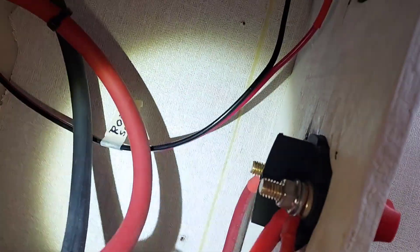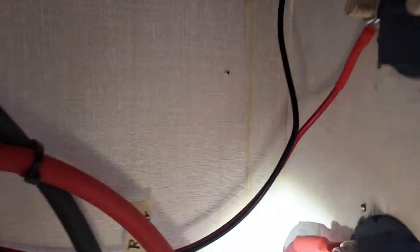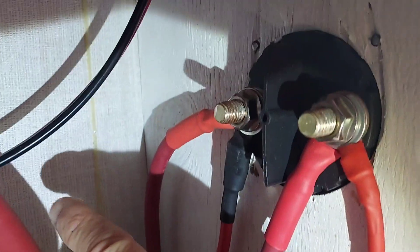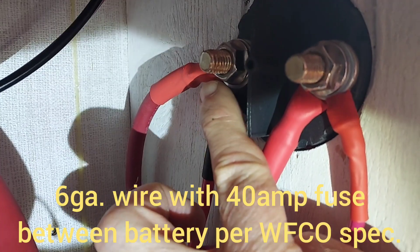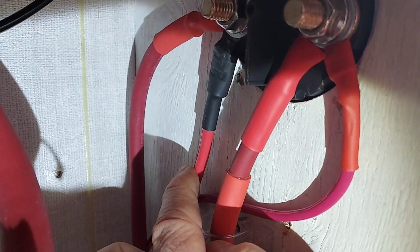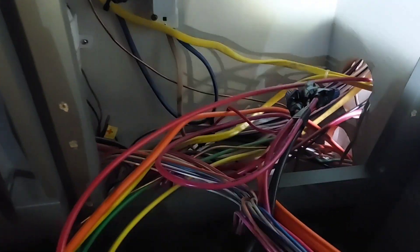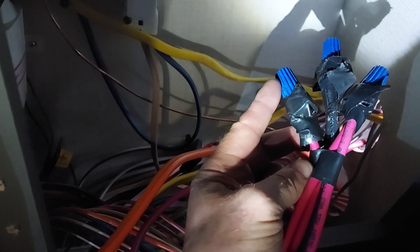We're pretty much going to eliminate that old run and hook it to my switch here. On the battery side I have my new cable right there — it's coming from the converter to charge the battery, it's only four feet long, and it goes down into the holes that go into where the control panel is. Here's our wire coming from the switch and it's going to get tied into this one, which is the one that goes underneath the trailer and under the bed. The control panel is down there underneath the bed with a switch, and then it goes all the way back out to the hitch where I have my original wire.